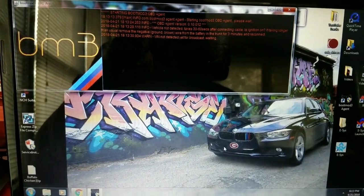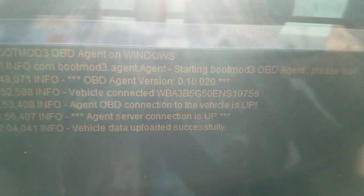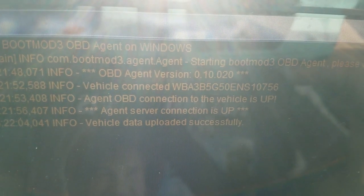Once we get to this point we actually need to get in the car to flash it. You're going to need an ENET cable — it's OBD on one side and Ethernet on the other — you can get this off Amazon, I'll put the link in the description. Bring your computer with you and plug it into the car. Make sure to turn off any power you possibly can because you'll be in accessory mode and don't want anything draining the battery. If you're worried, hook up a battery tender to the poles in front of the car. Also, make sure to buckle your seat belt — something about our BMWs is that plugging in the seat belt prevents the DME from going to sleep. You can see it actually connected to my car and the agent shows the OBD connection is up.